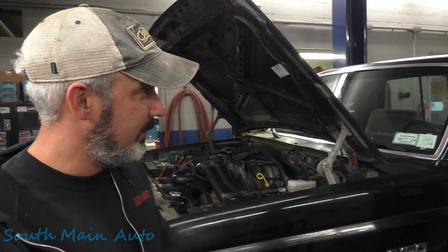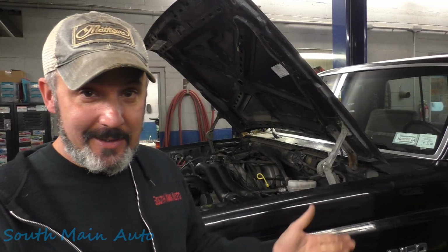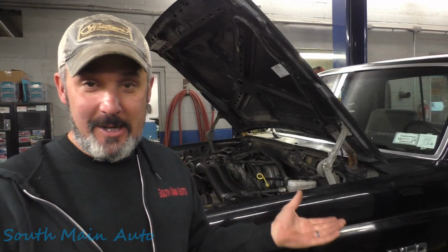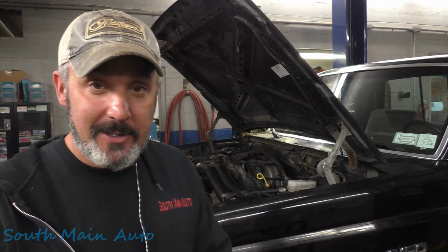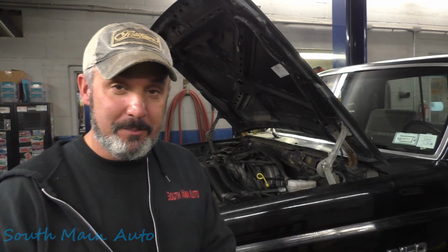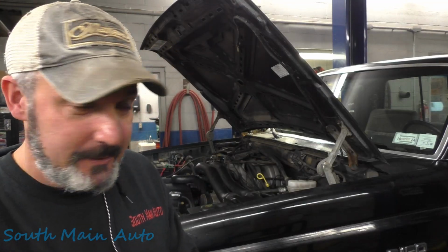It's a Southern truck of some sort, because obviously, 31 years old in New York State, or 32 years old rather, it's not from around here. I don't see any brake fluid leaking under it anywhere. It's not coming out of the wheel cylinders, calipers, nothing. So therefore, it can only be going one place, and that's down the booster. And sure as heck it is.